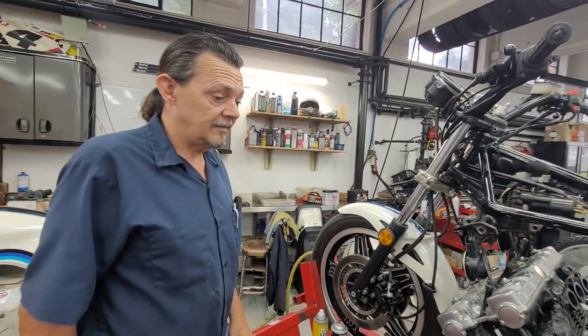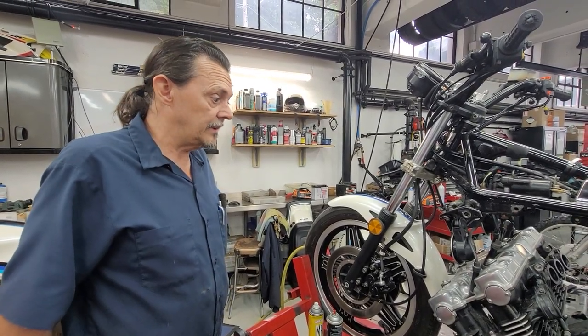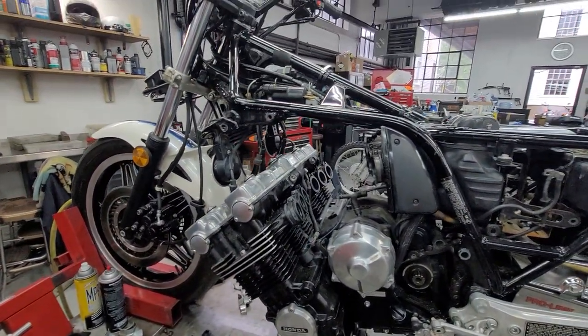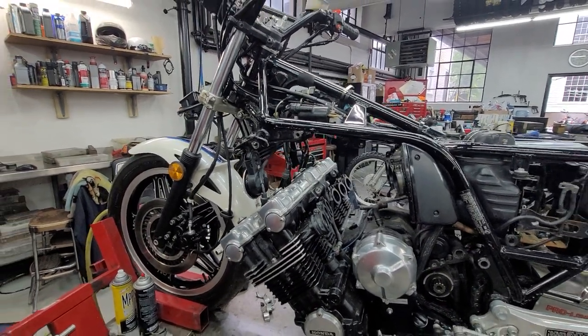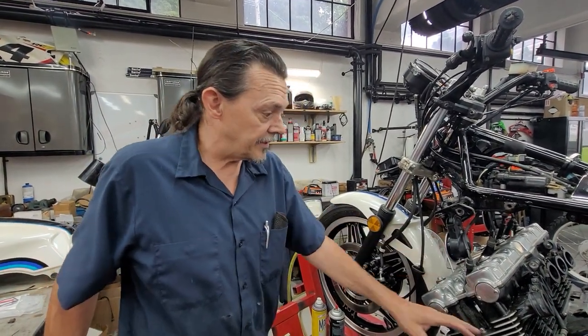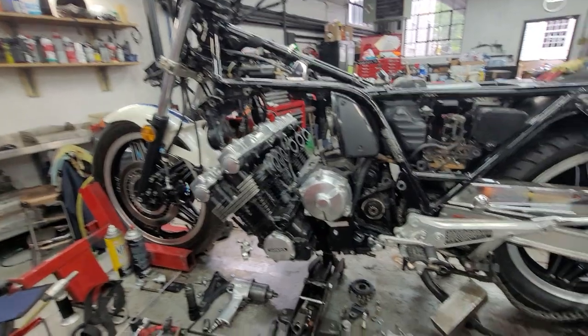What do you think caused it? Because it was such low miles — yeah, just from storing it with the ethanol fuel. It literally maligned and shrunk the seal. You can see the white residue on the O-ring right there. The carbs look great, the bike looks fantastic, but there's no way it would have been rideable with gasoline leaking out of it. I did start it before I started working on it and it was sputtering and not running right. But these things run beautiful — these six-cylinder engines, 24 valves, it's a four-piece camshaft. It's a very smooth, quick-revving engine.